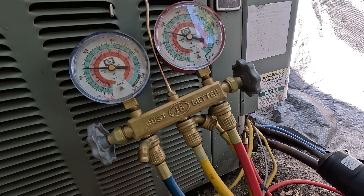On the blue gauge, you really don't want to be above 90 at any temperature. Once you start getting around 90 on the blue gauge, your AC is also not going to work very well. Right now we're getting pressures of around 71 on the blue side, which is actually very good.